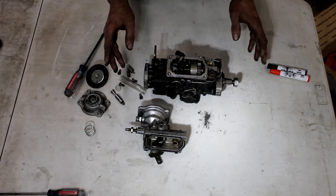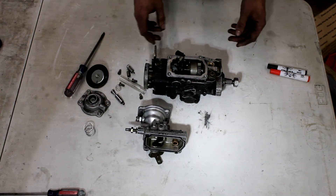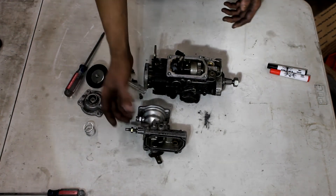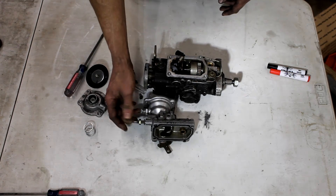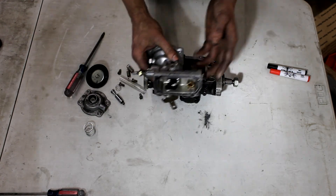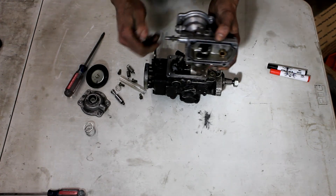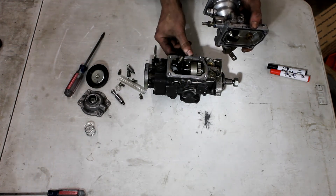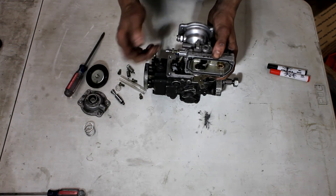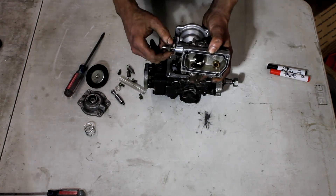I hope you guys enjoyed this. I don't think I missed any secret modifications - we went over fuel pins, governor springs, all that jazz. We went over KSB, and how to safely put the pump top back on and how to get the fuel metering screw set up. If you can remove the idle stop and the throttle stop, and if you have your indexing done right, you can use the indexing as well as the setting on the fuel metering screw to set the idle.